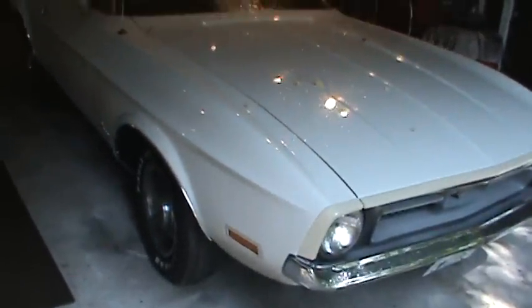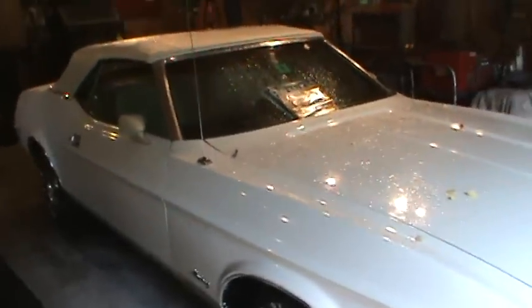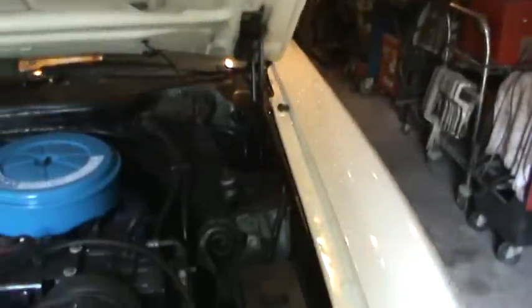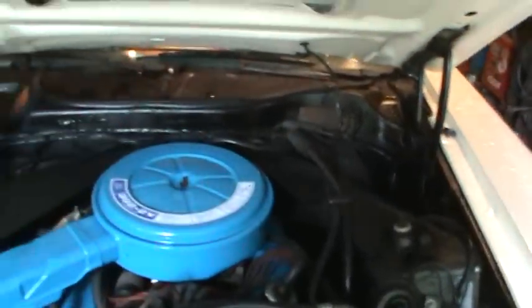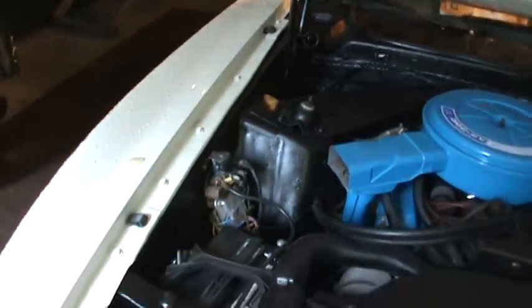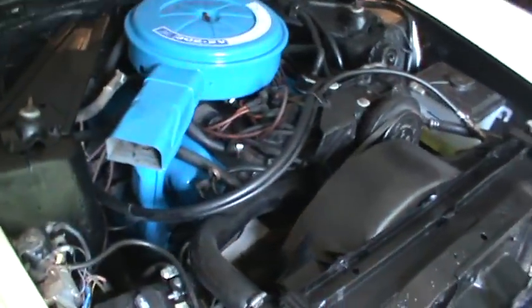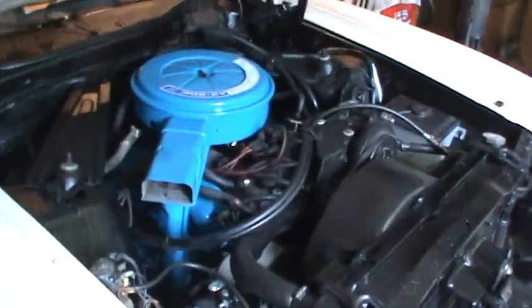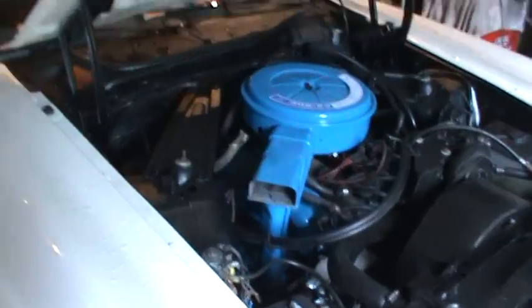Hey Youtubers. I'm going to do a little walk around on the Mustang — she's pretty much all cleaned up and done, pretty much whatever I wanted to do to her. The interior's put back together. I did the engine compartment, masked off the fenders. This thing had a bunch of overspray from the people who painted it before, so I took it apart and cleaned her off. Did the valve covers while they were off — sandblasted and painted them, sandblasted and painted the air cleaner, and just kind of semi-flat satin blacked the crusty engine compartment out.